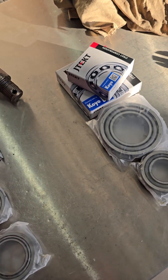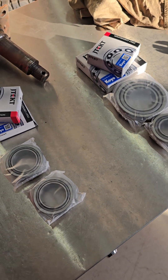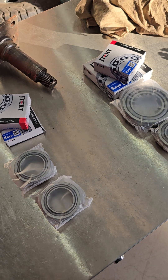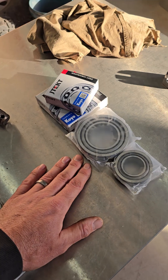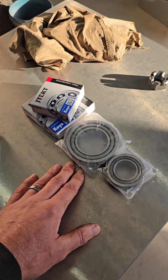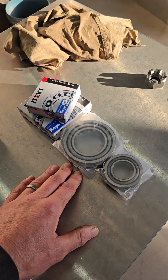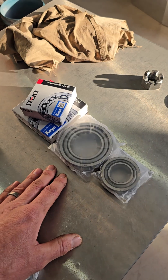There were other bearing configurations in T-Van — very early T-Van, some on slimline, and in early Mark V there were some variations primarily in five-stud vans — but today we're just focusing on these two most common. Today if you buy a new T-Van they'll all come on two-tonne stub axles. Track has pretty much discontinued the 1.5 tonne ATM, and if you buy new asymmetric arms from Track directly, very likely they'll sell you the 1.8, so they'll come on this upgraded axle anyway.